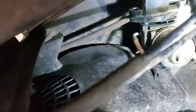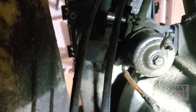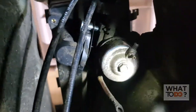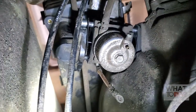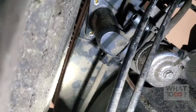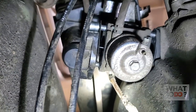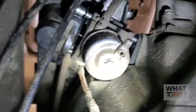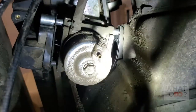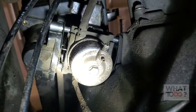If you look up here, it's a little bit of a mess — almost like somebody had done some work on this before. And if you look at that, your carburetor there is separated from the block. I don't even know how this thing was running, but that explains why it's jumping all over the place. You're sucking in all this air and debris, and it's barely touching the block. You can see it's got a real fine gap there.